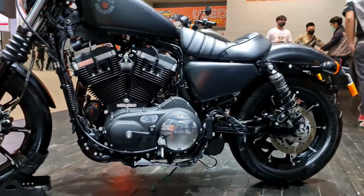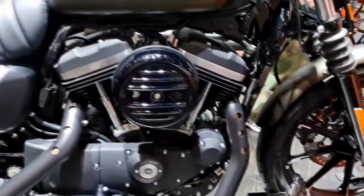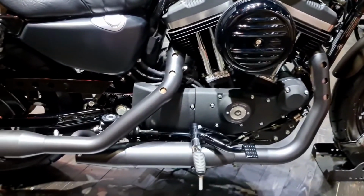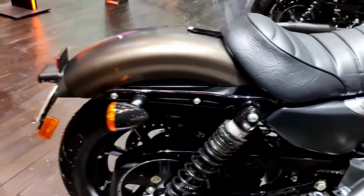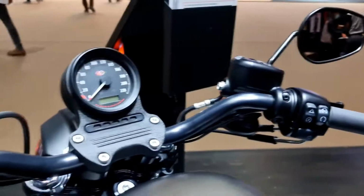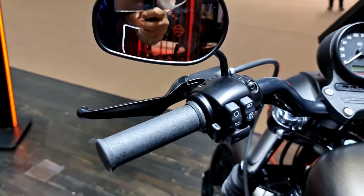In keeping with Harley tradition, the mill is an air-cooled, 45-degree V-twin. The 3-inch bore and 3.811-inch stroke give the engine a total displacement of 53.9 cubic inches, 883 cc, hence the devilishly clever name, and a throttle body with electronic fuel injection helps it crank out 53.8 pound-feet of torque at 3,750 revolutions per minute. This is plenty of power for zipping around town, and it comes economically at 51 mpg.